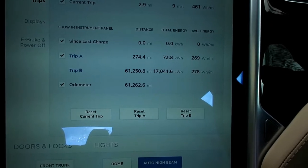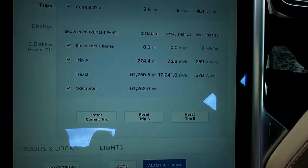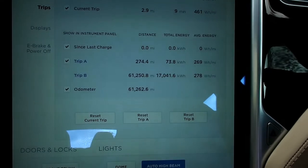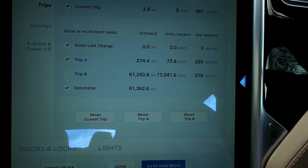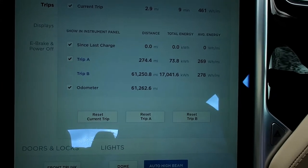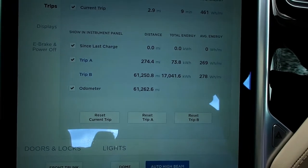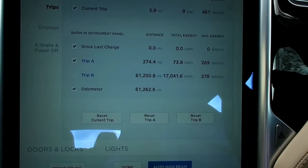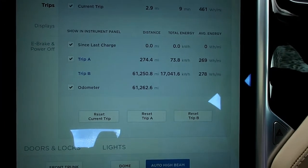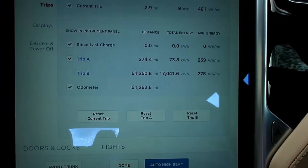It means you might be at the charger the odd minute or two longer. In reality, when I'm supercharging, once the rate drops below about 40 kilowatts I generally knock it off — that's at about two-thirds charge, maybe 200 miles on the clock — because the charging rate becomes slower and slower. And at the Tebay supercharger where there's only two stalls, it's not really fair to hog it beyond that.